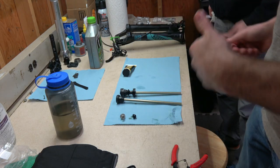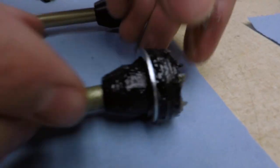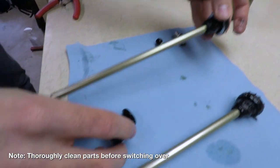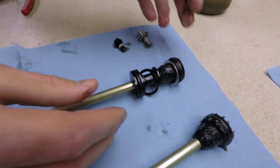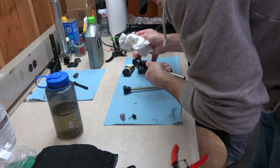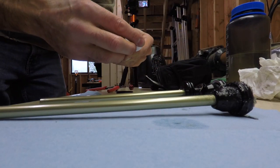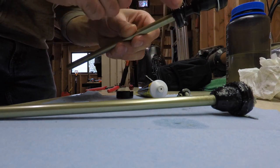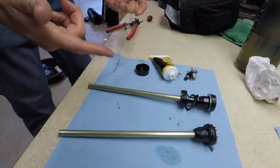So what do we do now? Just slide everything from one shaft to another. We're going to slide the components off the old and onto the new — there's a little washer up here too. Slide this on, slide this bad boy on. Give it a little wipe down and then we'll lube it back up. Now we need to re-lube with some more Slick Honey. You want to focus on the two seals. All cleaned up, lubed, ready to go to the next step.